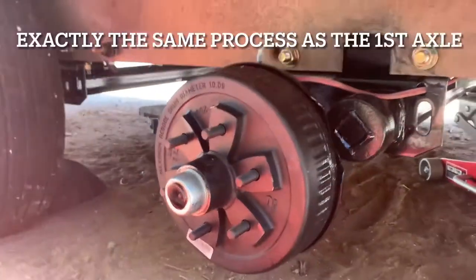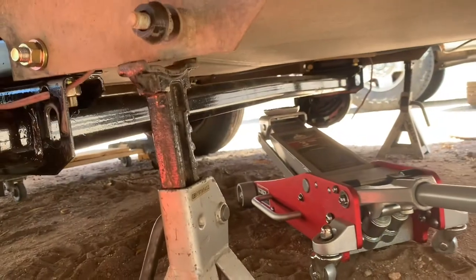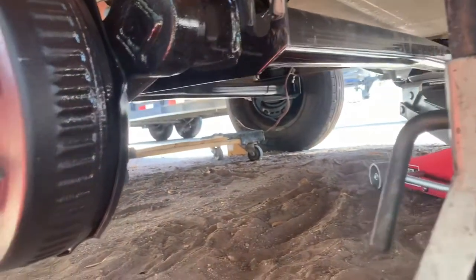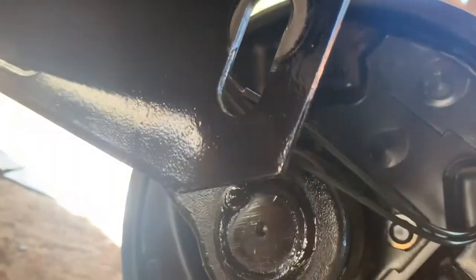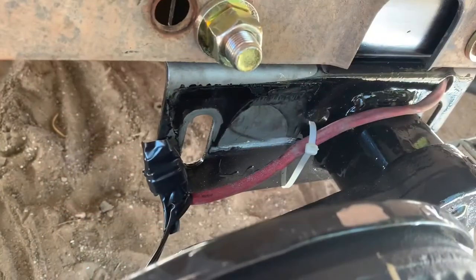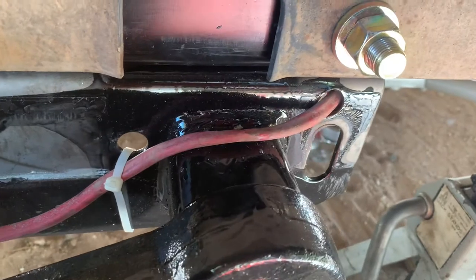Both axles are now installed with the 3-inch lift kit. Don't forget those jack stands — safety first. You don't want your Airstream to fall on top of you. Don't forget that you have to rewire the trailer brakes. Get some new fresh copper there, and then use one of these holes right here just to tuck that wire in so it's out of harm's way. You can reach back through here, and then crimp them together. Wouldn't hurt to wrap those connectors with some electrical tape and zip tie it so it won't get in the way of the wheel.